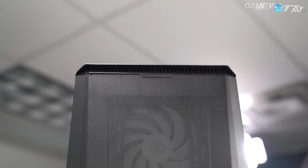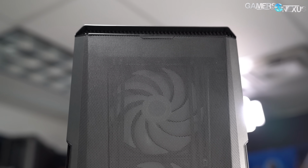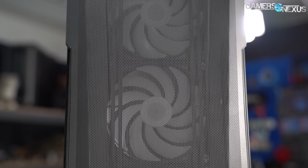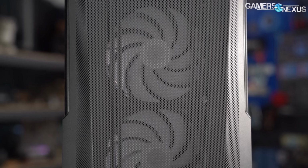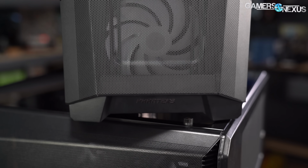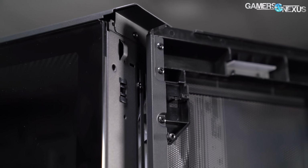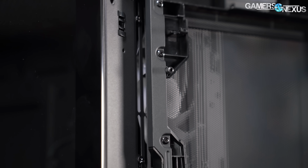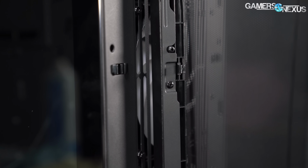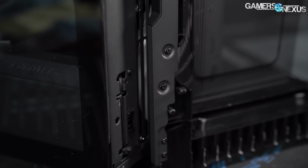The front panel has a U-shaped design stamped into it, which we were told at CES was potentially as reinforcement to prevent the front extra wide mesh panel from flexing. The panel attaches to the chassis with a ball and cup snap like other cases in the series, but uses plastic posts molded into the frame of the panel instead. Previously, these were metal posts tacked onto the edge of the metal mesh. The new method is probably cheaper, but seems just as sturdy in our short-term testing.